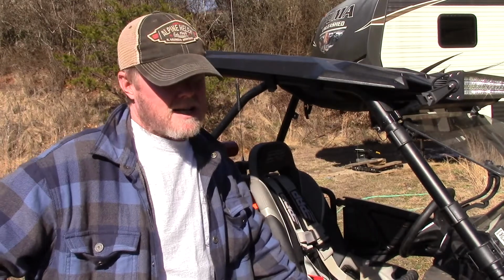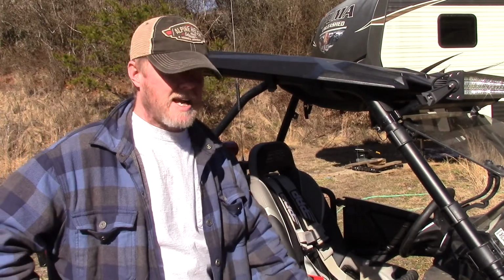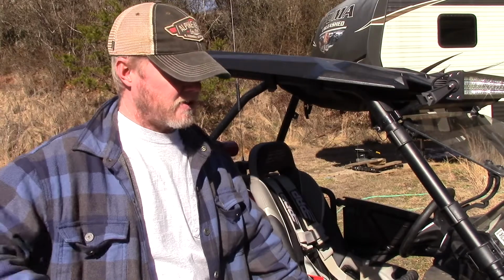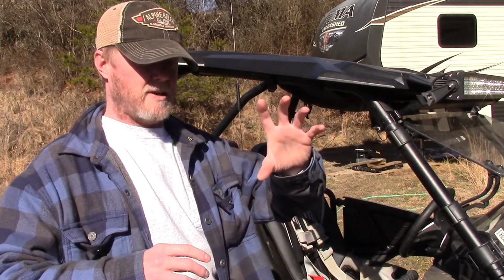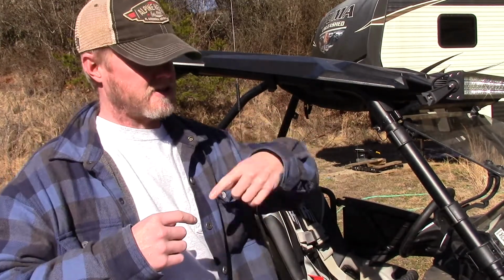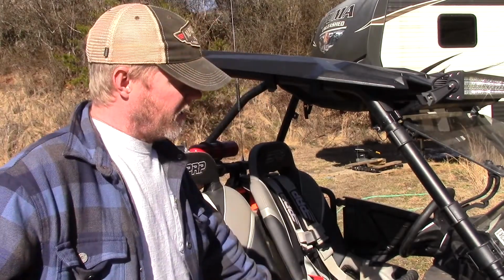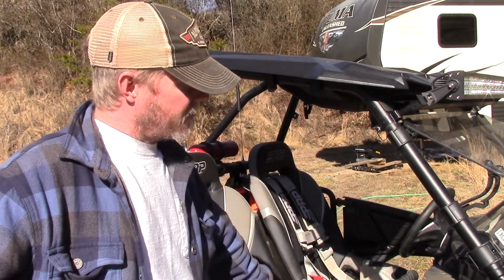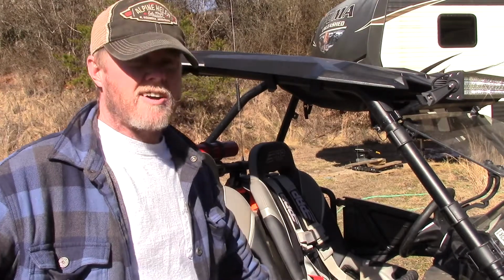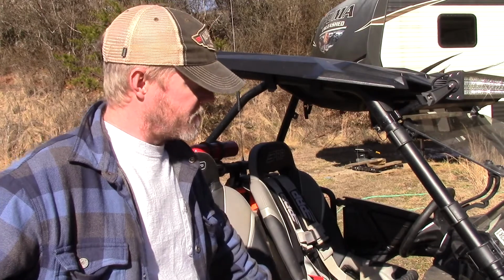Like I say, if you watch through the numerous CVT operation videos, you can see what's happening anytime that you're mashing the fuel and the tires aren't moving. Basically, the belt and your secondary is staying still, and your primary is just wallowing out your belt. Back this on. I'll do a quick demonstration of it, show you what I'm talking about, both in level and going up a little bit steeper grade here in just a little bit.